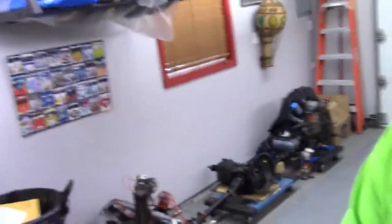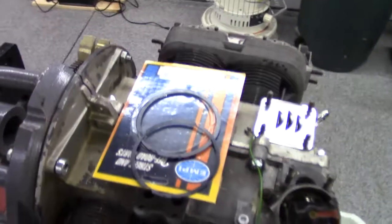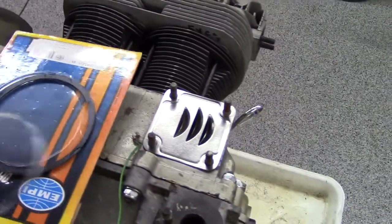I put this together kind of thinking — this is my third VW engine build so I should know better. Shame on me for being lazy. I thought I'll just run it and see what happens. I was talking to a guru buddy of mine and he said don't do that, just go ahead and shim it up. My hangup was that increasing deck height will decrease compression, so I thought it might be a power difference — but it's not going to be significant enough. So now I have these barrel shims.